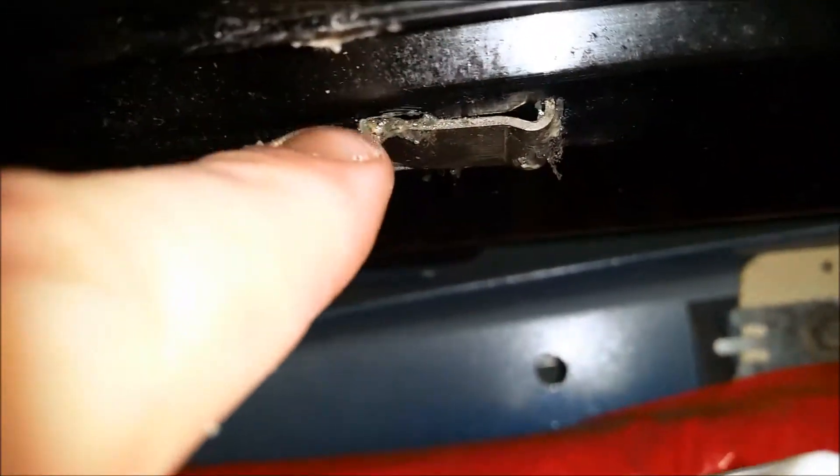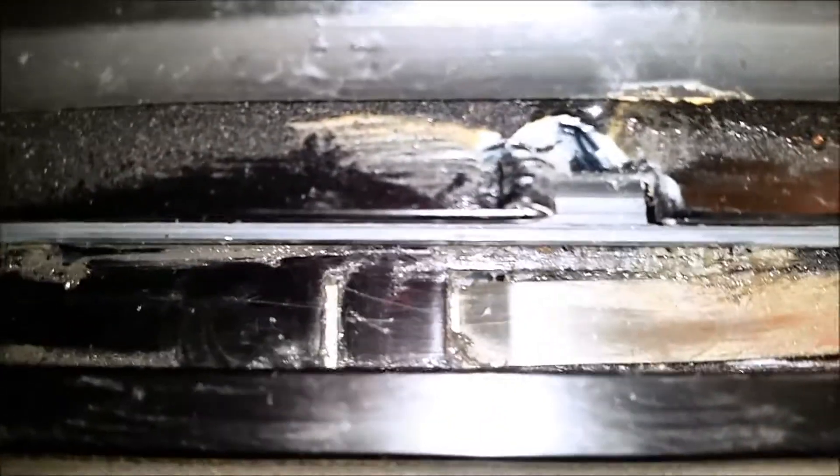In the front, the main problem where it's gushing out is this little piece right here — this hole. On my sunroof, I have this air diffuser at the top. When the sunroof is open, it prevents the inside from flooding with air. It has springs that go over to these holes. Now, that hole right there — where the thing is shaking — is literally the inside of the car on the other side of the sunroof drain. Water is going through there and gushing. You can see this black stuff — it looks like GM put some grease there to plug the hole, but grease dries up and wears out over time.